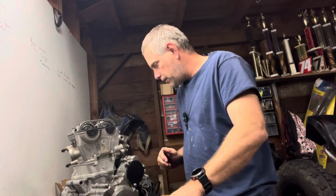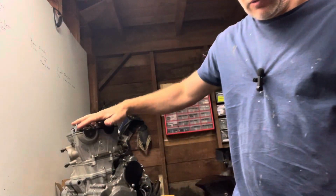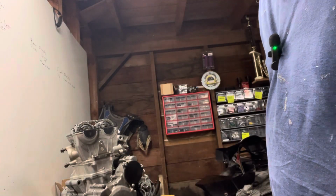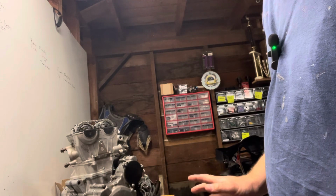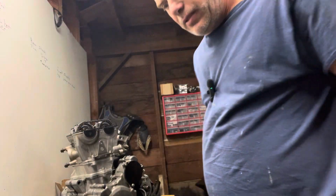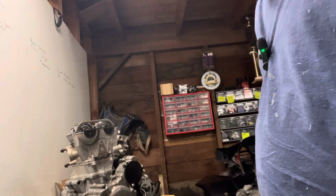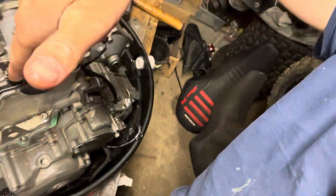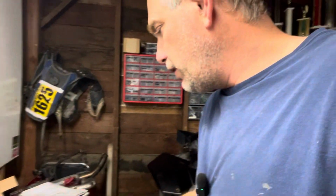And that is how you put your cams in and adjust your valves in there. I think that's it. Again, top dead center. Make sure you put those little sleeve pieces in there, and then it's pretty simple. You just don't want to drop any of those pieces down inside there. I have. It's no fun actually. Last week I dropped one in there and I had to pull the whole side case right here. You pull that off and you can get in there.